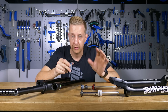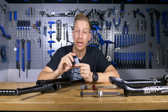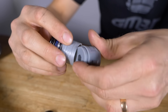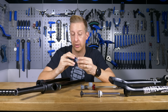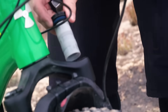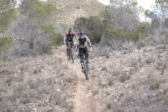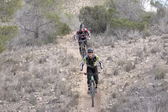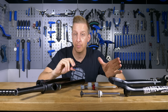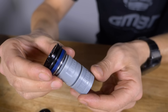If you do have the regular version that doesn't require a cassette tool, I suggest you make sure you have a really good quality flattened socket for this. You might notice on the top of this one there are two gray spacers — these are air volume spacers. They're called different names depending on the forks, whether you've got RockShox or anything else, but essentially they are air volume spacers. They are there to change the ride quality of the air spring. More spacers means the fork is going to ramp up more — it will feel more progressive, very supple on the initial part of the stroke, and then it will almost resist bottoming out. Less means the opposite — you're going to use all that travel a lot easier. Depending on how much travel your bike has, how you like to ride, and your preferences, you can tune the way it feels by adding or subtracting those from your air leg.